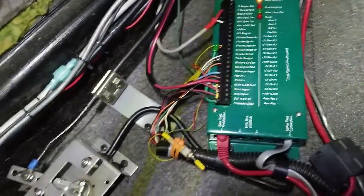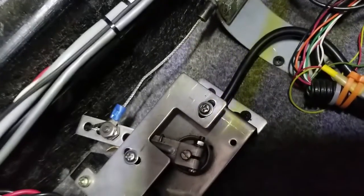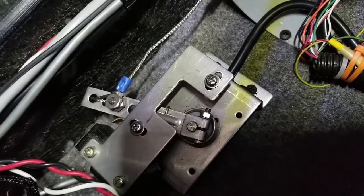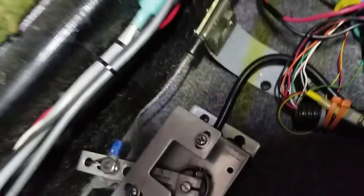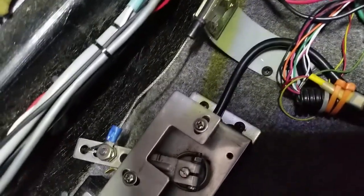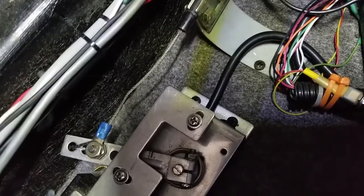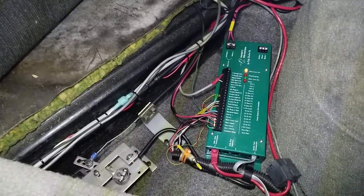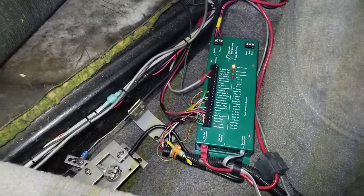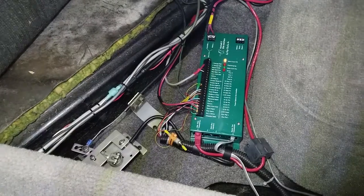You can see the red ethernet cable snaking around and going into what the manufacturers call the hairball, which is the brains and controller of the motor controller. And this all gets input from a 5k-ohm potentiometer controlled by the original throttle cable, located in the compartment behind the driver's seat.